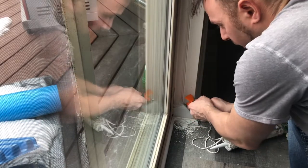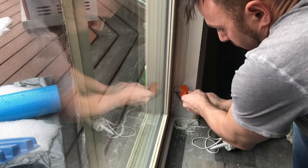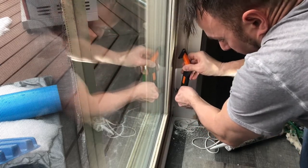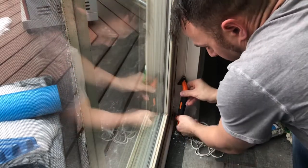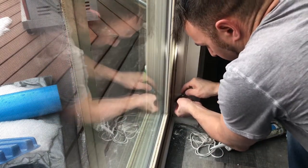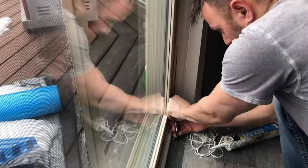That's how you remove it. Now I'm going to show you how to caulk. What you're doing is prepping the area — cleaning it, removing any dust or loose debris. Anywhere where it's cracked, you want to remove it. If you can see that little crack line, get rid of it so you can shove some new caulk in there. It's also nice to have a razor blade handy to get up in there because that tool is not going to get everything. Entirely prep your area and remove any loose, cracking material.